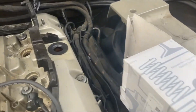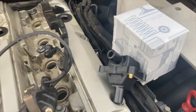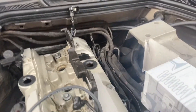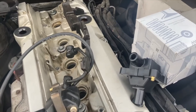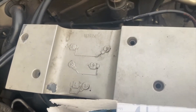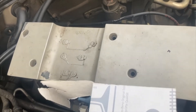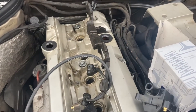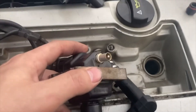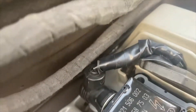Obviously up here — I don't know how the wiring harness goes together, or what all is impacted by it, or if that's an easy thing to swap out. So I'm going to try resetting these, just following the alignment that's on there. When I did that, the car started but one of the cylinders definitely was not firing, and my guess was that it was probably number six.